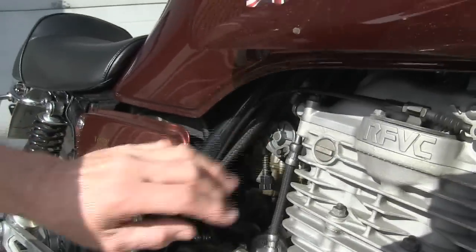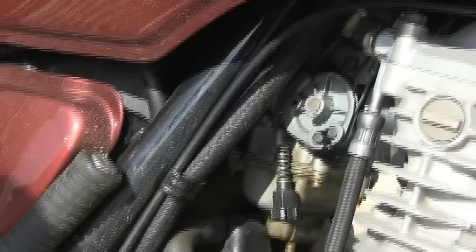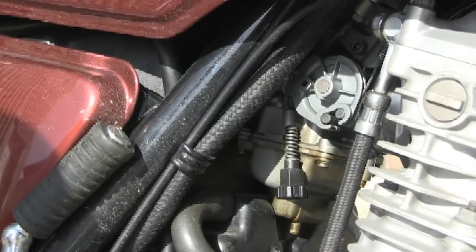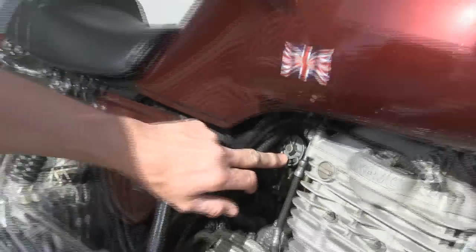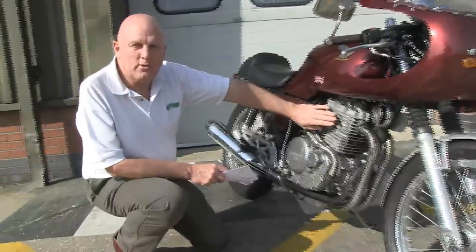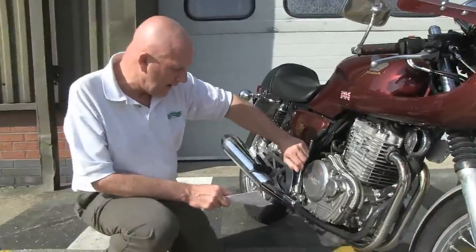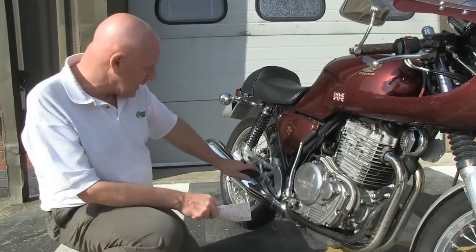In here, I suppose it's probably a Keihin or a Mikuni, I'm not rightly sure, but what it is, it's massive. Let me tell you what the size of the carburetor is, just have a look, I wrote it down. Yeah, 39mm, that's an inch and 9/16, so that's bigger than the Goldie's GP carburetor. Nearly. Compression ratio is about 9.2, 9.3 to 1, something like that. And, as I say, about 44 horsepower kicking out.